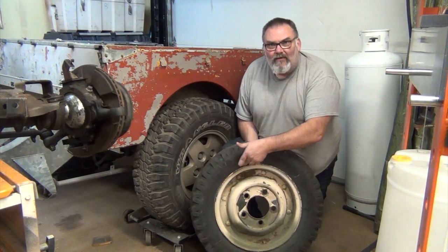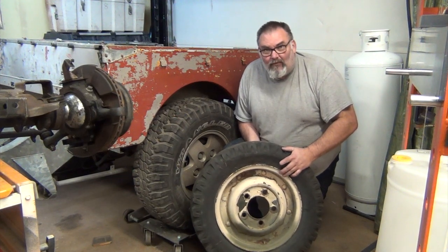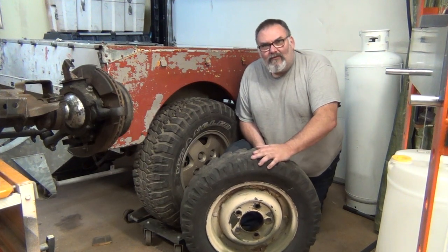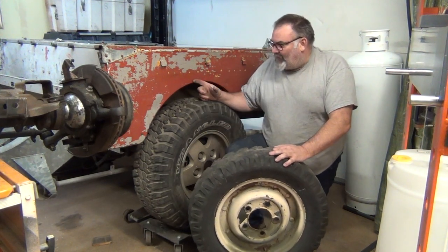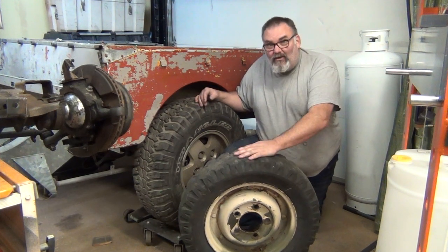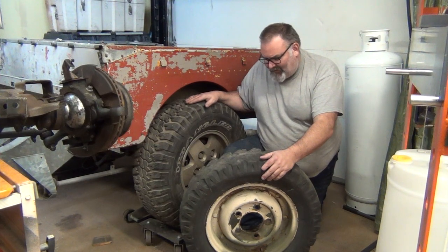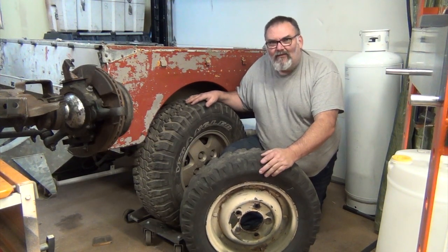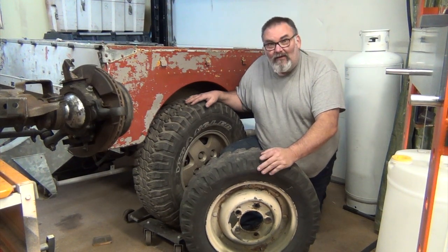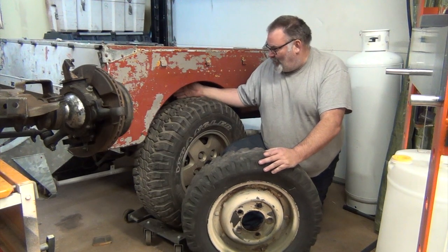They bolt in through here rather than having that common split ring. A lot of the World War Two jeeps had the same rim by the look of it, or at least an almost identical looking rim. Just out of curiosity I grabbed this one as a test rim, just to see how wide it's going to be. Currently with this rim and tire setup we're about three to three and a half inches out from the side of the body. This one has quite a big inset and less offset compared to a lot of other Land Rover rims. I understand there's an endless list of Land Rover rim numbers with all different offsets and sizes — these just happen to be available.